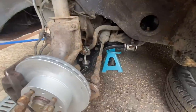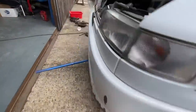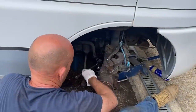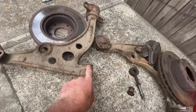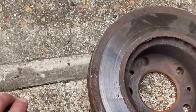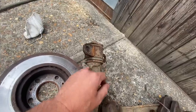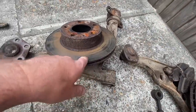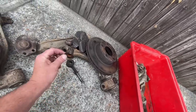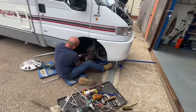There we go — nice peace of mind. New lower arm, new discs, new pads, new drop links — it's all done. The track rod ends have got no play in them at all, so they're fine. You can see all of the old bits off of it, and I think you'd agree they definitely wanted doing. The rubber is perished, the ball joint has a fair bit of play in it — it shouldn't be that loose. The back one also shows some perishing. And the discs, although they'd come back from being sat around for a while and you probably could have got away with them, they've been changed. Both were seized on — Chris actually put the slitting disc through them and got the Stilsons on them to get them removed. Definitely going to be a well-sorted motorhome once it's all back together. That's that side complete.